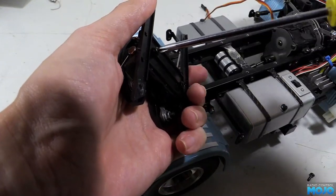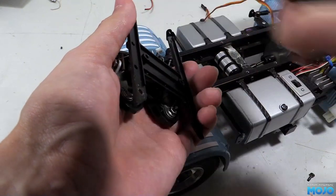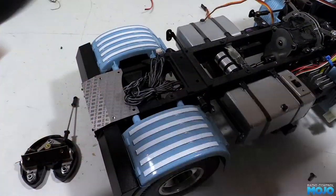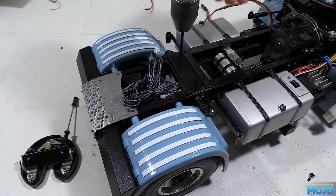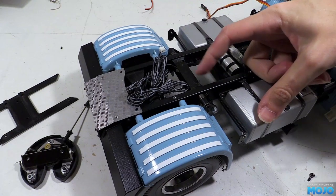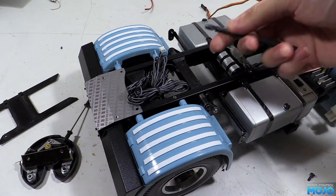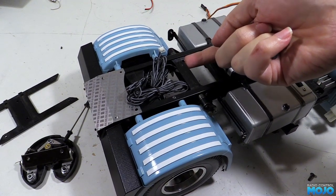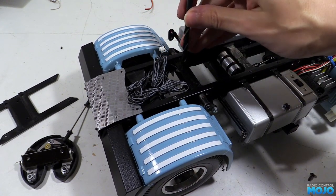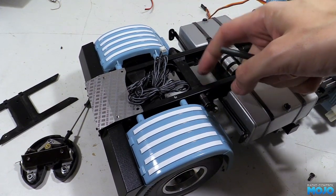First we remove the coupler and the plate, then mount the plate to the chassis with a couple of its screws. Now we can use the plate as a template to drill some pilot holes in the cross member. Remove the plate and we can see the two holes. We'll need to take them out to around 6mm so there's plenty of clearance. Unfortunately they're right on the edge so we can't use a drill as it would slip out unless we clamped it all down and used a pillar drill. It's going to be much easier just to use the holes as a guide and extend them with a Dremel.